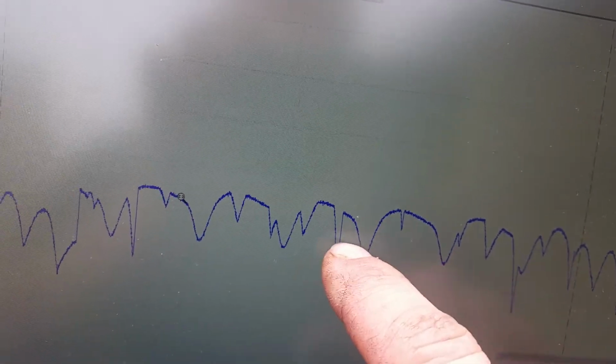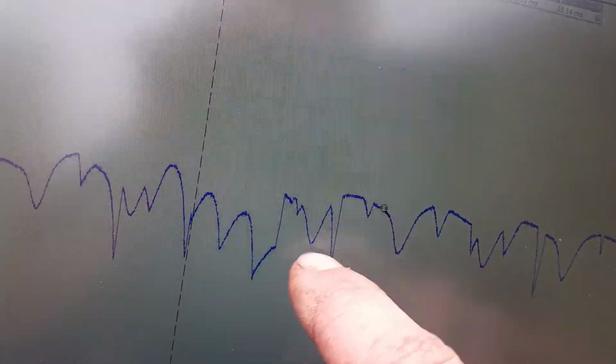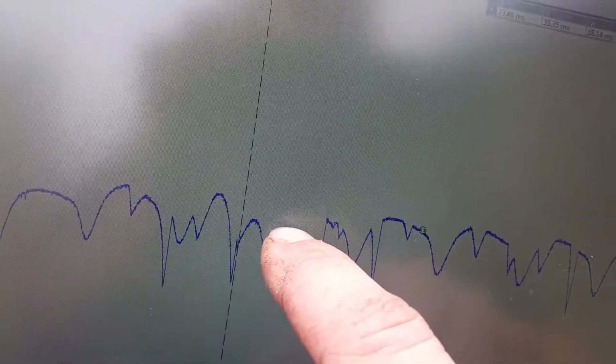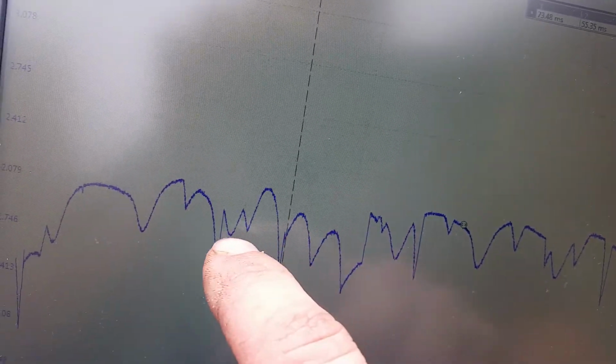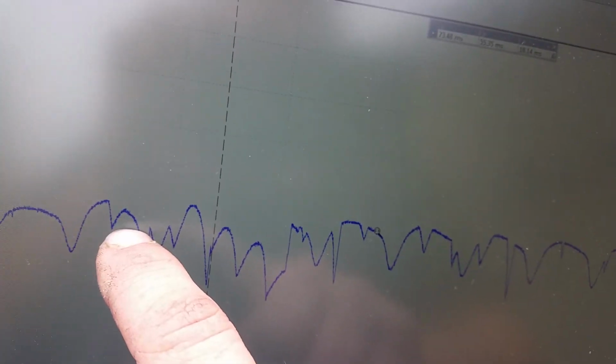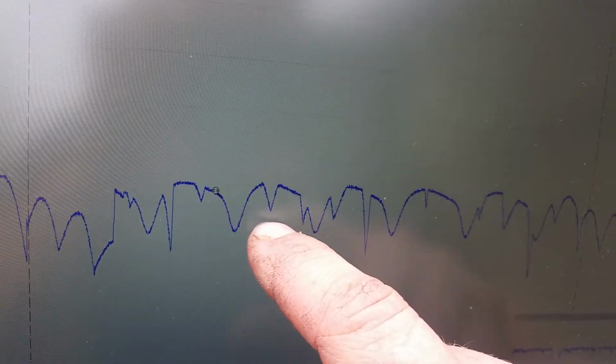This is like my healthiest one. Each one of these breaking up is showing there's some wear in the motor, and these two right here are almost like dead. So this part of the motor is really like stalling out. So with the RPM, it's able to run from this decent commutator and kind of scoot across these to the next one that actually makes some RPMs.